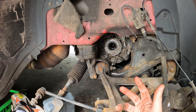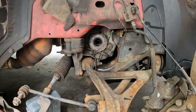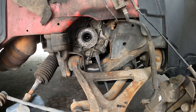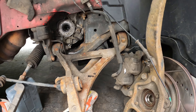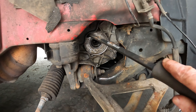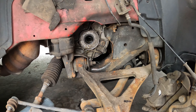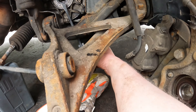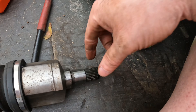The axle is out — let me teach you guys how I did this. I said a quick prayer and then before the last time I took this off I had an idea: put the small pry bar here, put my foot here like a brake pedal, then took the other pry bar on the top, put it about right here using the bracket as leverage, and hit it. That's what I did and it came out. You guys can see the axle — the splines are fine.